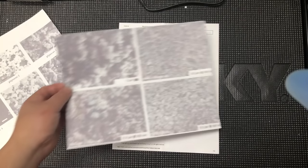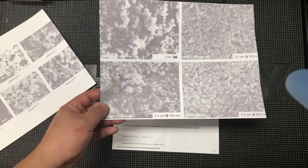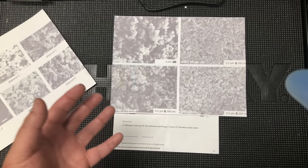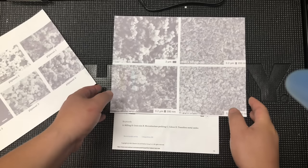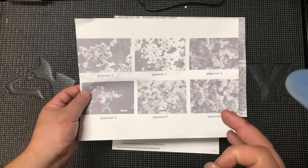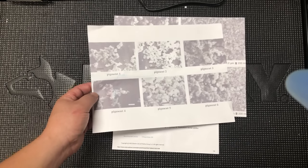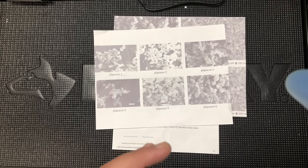If we use an electron microscope to zoom in on the pigment particles, we'll find their shapes are not round balls. Instead, the particles have holes within holes, which make the particle surface extremely large compared to its volume. These holes and tiny volumes make the particles physically attract to each other or to the paper surface. Therefore, the pigment bond is a physical bond and not a chemical bond. Anyone saying their cleaning solution can dissolve pigment is not telling the truth.